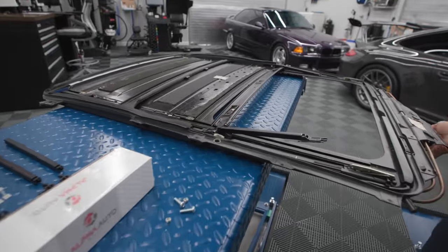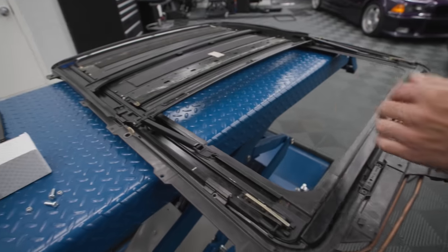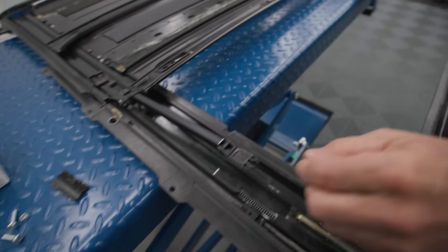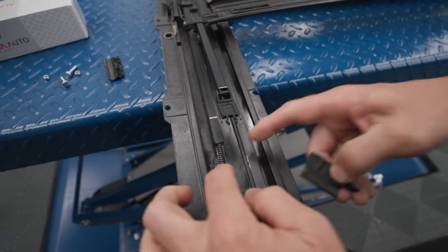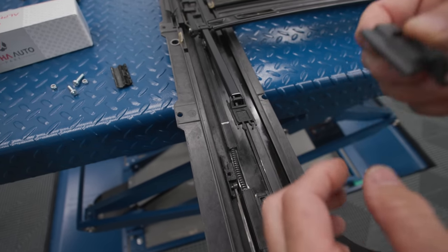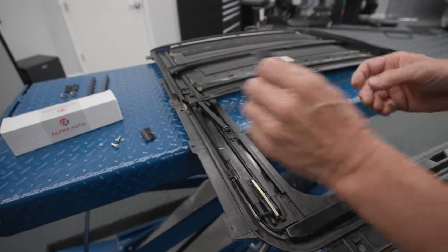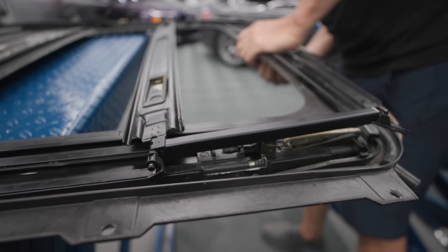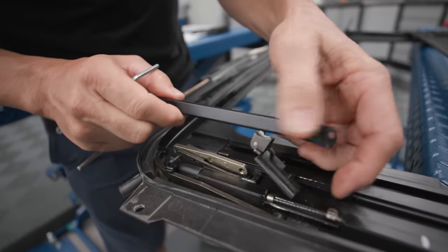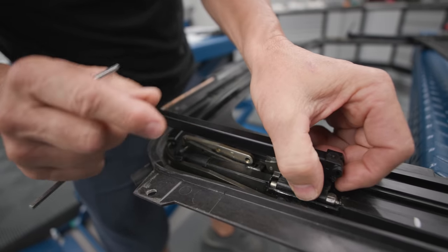We'll get started pulling it out. We got the motor installed back into it, and there's a crank that comes with the car that you can use to manually override the motor. That's actually how you get it apart. Once these are out, as this comes out, these pieces that are normally captive can actually come out. There's a spot in the cable where the spiral wound section is not there - this drops in, and there's a tab on either side that pulls it along with the cable.